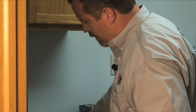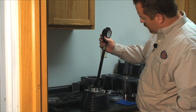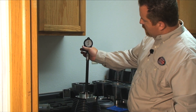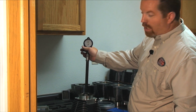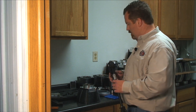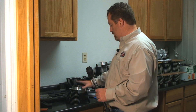Then you take the cylinder you're going to check and put the gauge inside it, rock it back and forth until you find where your size needs to be. As you can see, this cylinder is about a tenth or two oversized, but that's within our tolerance. We always like to be a little bit bigger instead of smaller so we don't have seizing issues. But a tenth is very, very minor.